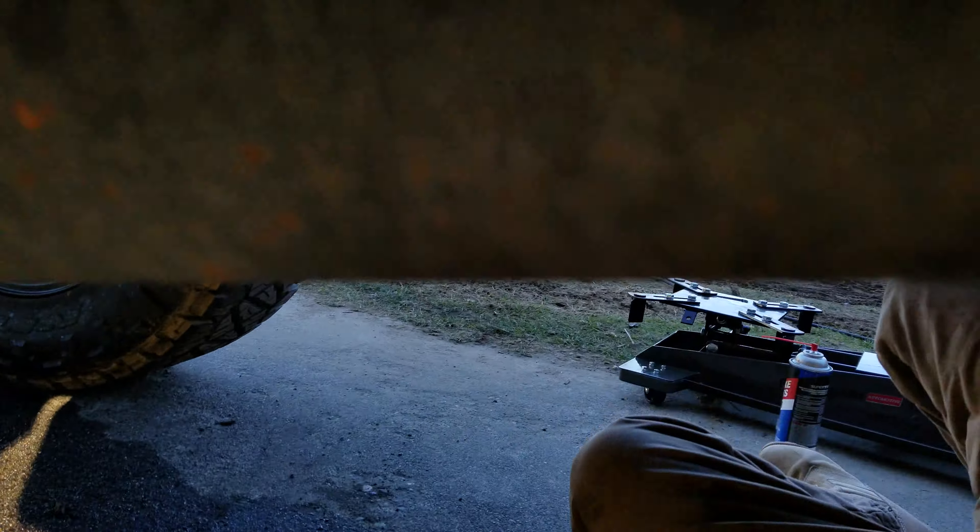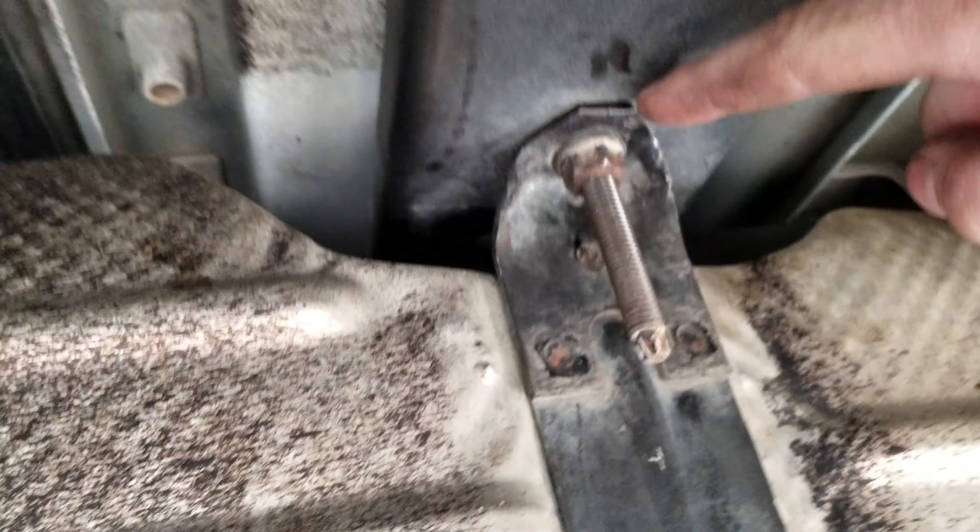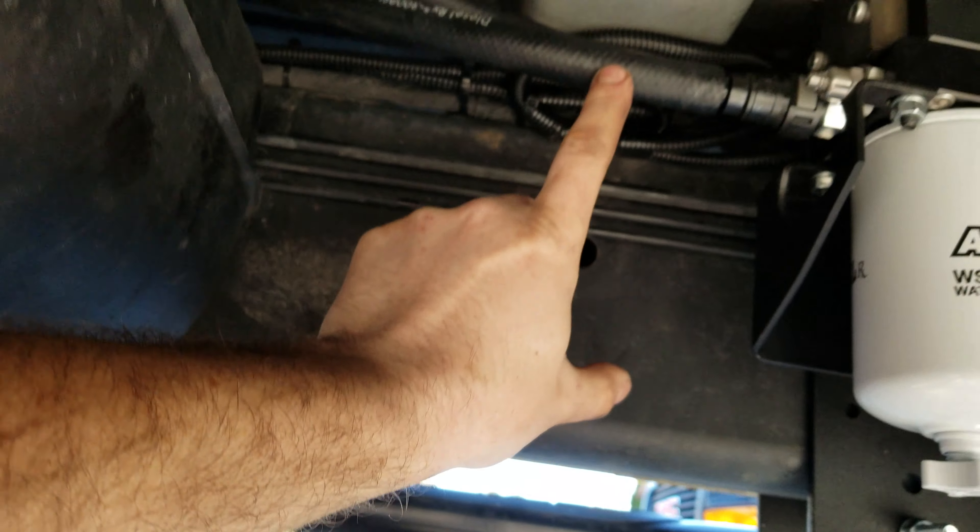Don't mar it up — protect it, that's your moving part. You're probably not going to be able to see it from the top, but you can see my setup. The kit comes with the sump kit for the fuel tank — the upgraded sump kit; the 4G does anyway. I've got everything routed up over the new fuel lines, over each of the bars so it doesn't pinch between the tank and those bars. Supply line coming in, return line going out.